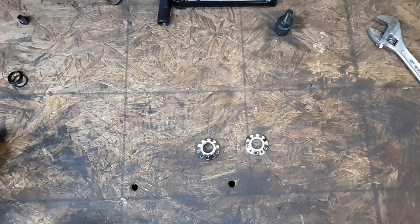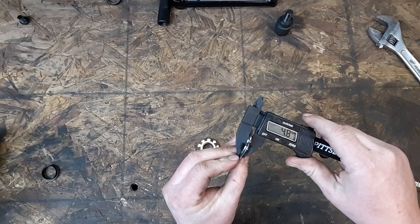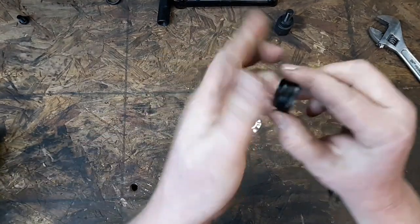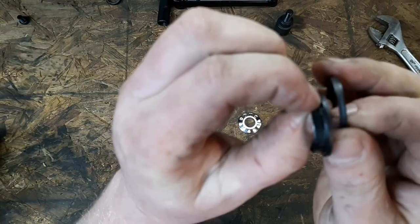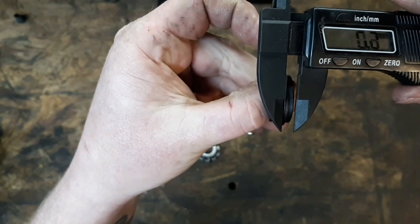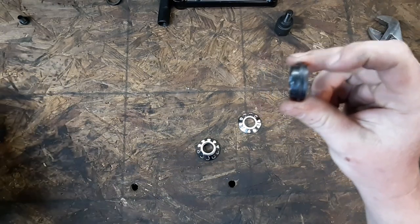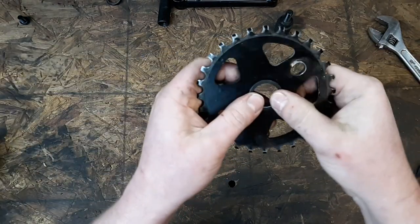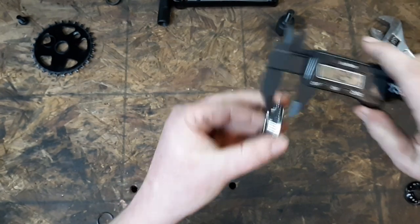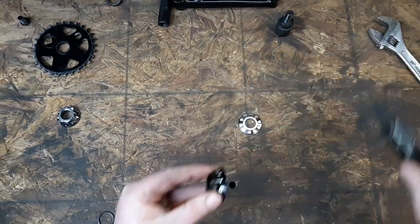These are the spacers off my pre-existing crank set and we're going to match them as far as thickness goes — looks like 4.8 millimeters. So here's my 22-millimeter adapter. We're going to measure the thickness of this shoulder plus a spacer until we equal 4.8 millimeters. For the non-drive side I was at 12.4, and the closest spacer available to me is 12.2, but that should be fine.